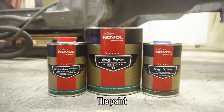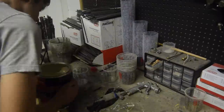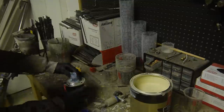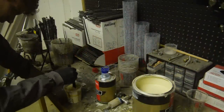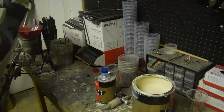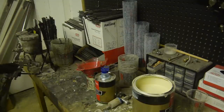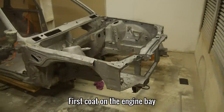This is the paint I've gone for - a 2-pack anti-corrosion epoxy primer from Novol, a primer specifically for car chassis and one that is designed to be painted over with 2K paint. This is the type of paint I should have gone for right after the car was blasted the first time. Even at the correct ratios this paint is super thick and requires a 1.8mm nozzle to spray. I have a 1.4 to 1.8mm so this might be a bit of a squeeze, but I can always reduce the spray pattern to put more paint down at once.